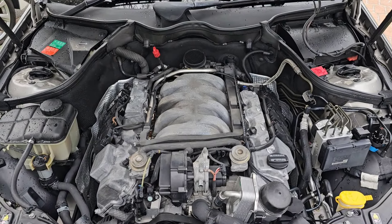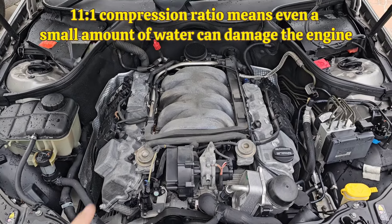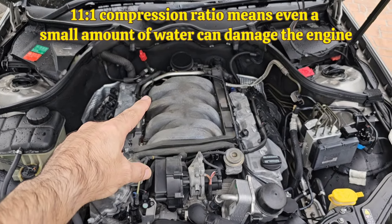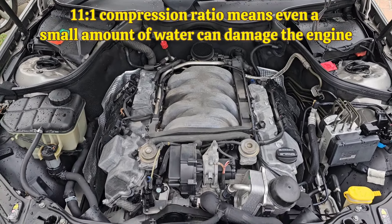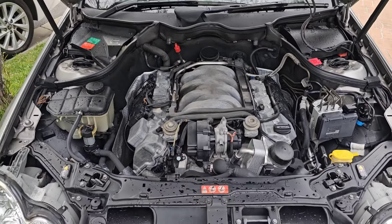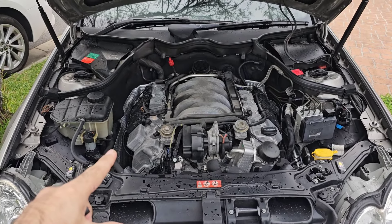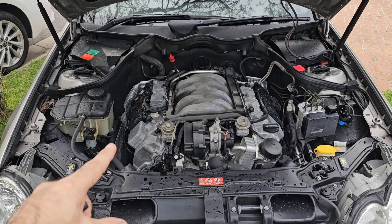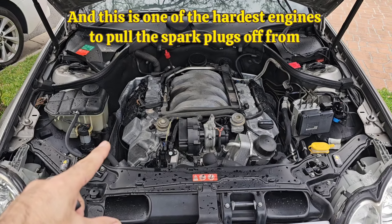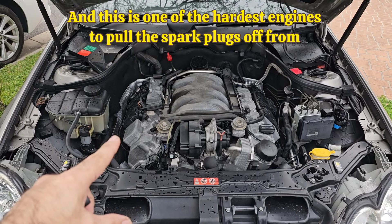I am concerned about getting the engine hydro-locked. So a lesson to learn from my mistake: always cover your throttle body and intake manifold. I tried to crank the engine but it had the symptom of being locked, so I didn't attempt it again. Now I have to take 8 of 16 spark plugs out and crank the engine to make sure it's not going to lock. So stay tuned, I'm gonna make it quick.